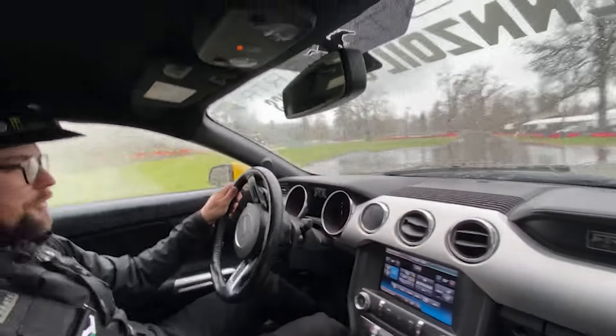The reason it's two-piece is because on a Mustang the tie rod has to pass through it. If you've ever seen our FD cars, we have a huge step out to clear that. Rather than doing a crazy shaped arm for this model, we've done a sandwich setup, which also gives us some adjustment in this section - actually better than our FD cars. But our FD cars are set up only to work the way we want them to.